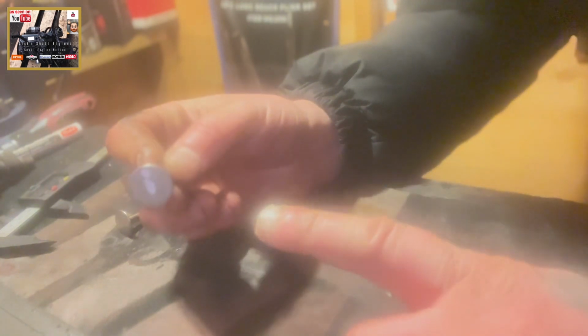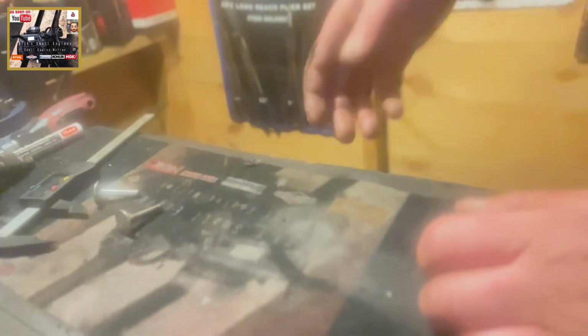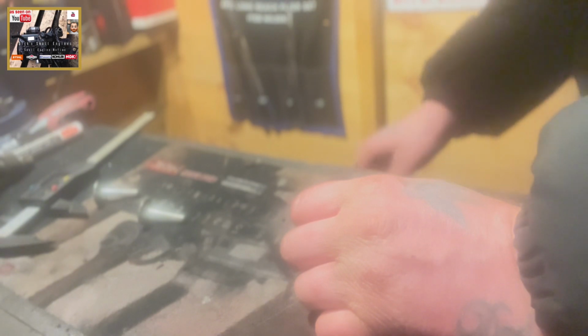So let's say hypothetically this is your intake, you've marked it up so you can distinguish it when it goes back in your engine block. That's your intake. Bit of electrical tape, whatever, just so you're aware, even if your valves are out, your intake tappet can sit next to your intake valve, and likewise with your exhaust tappet. Simple as that. Now the reason we want to do this, I will show you as an example shortly. In fact, I'll show you in a sec.